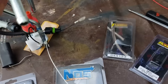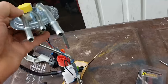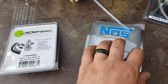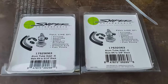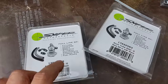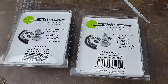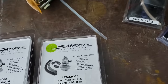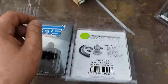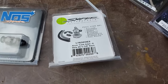This middle line here is for evap, the smaller one is for return, and the larger one is for feed. I found these little tube adapters that work like compression fittings — these are NOS systems, they're discontinued so I only paid a dollar fifty each. You can get them on Amazon and I'll have a link below if they're still around. What I'll have to do is cut off the flare, and then I'll show you how these go on.